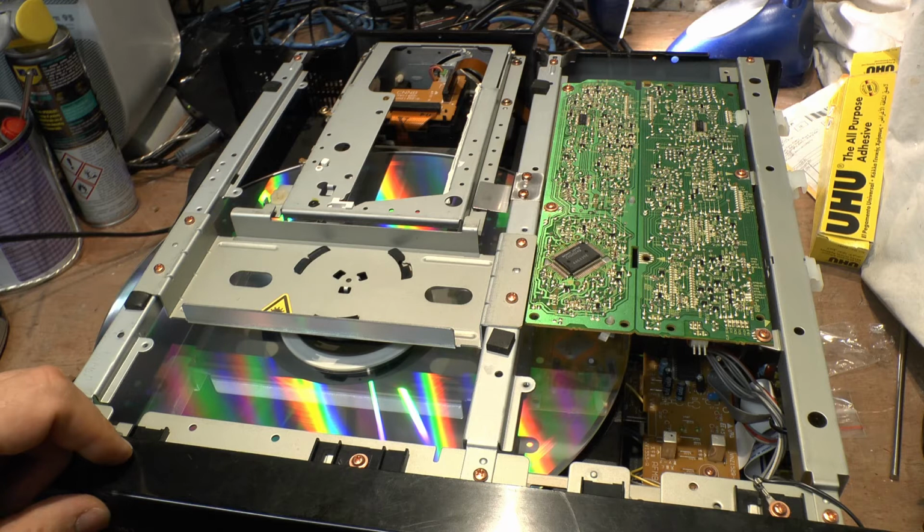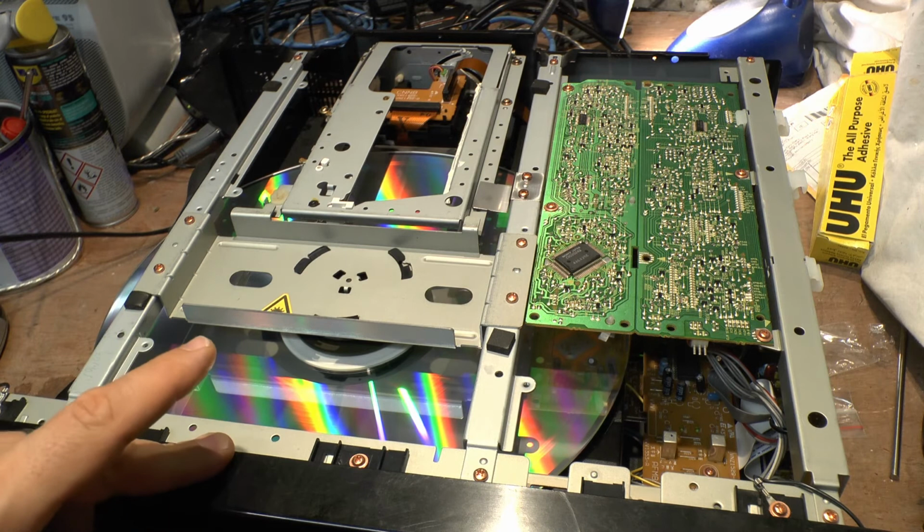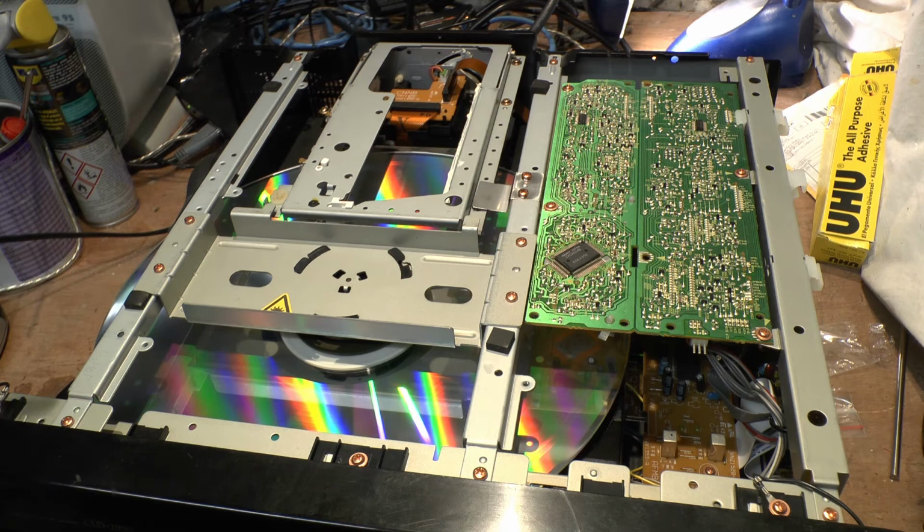So if you're looking for a machine that'll play back a disc with a scratch in it or some sort of imperfection, I would definitely go for the CLD-D925s, not this one. This is looking for discs that are pretty perfect, and it's not the first player. This is the third one of these. I've got two of these drives, one that's not working, but when it did work, and the 1950, and they all have the same issue when playing back this particular disc, whereas I don't see that in some of the more modern ones. They seem to play over and have no problem with that. So that to me would tell me to avoid these players if you can. But if it's the only one available, then go for it, because most of them are going to play back anyway. Right, okay.